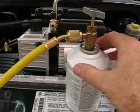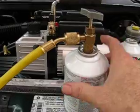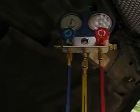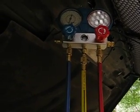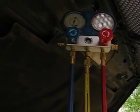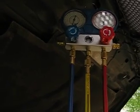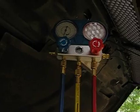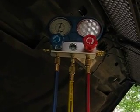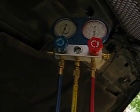I don't just leave it in there — I sort of just dip it in for a few seconds and pull it out. As you do that, you can monitor your low side. You'll see when you put it in the hot water the pressure will jump up 5 or 10 psi, then when you pull it out it'll settle down. It's a way to get it in quicker and it's safe. It's hot tap water — you don't boil it or anything, just out of the faucet.